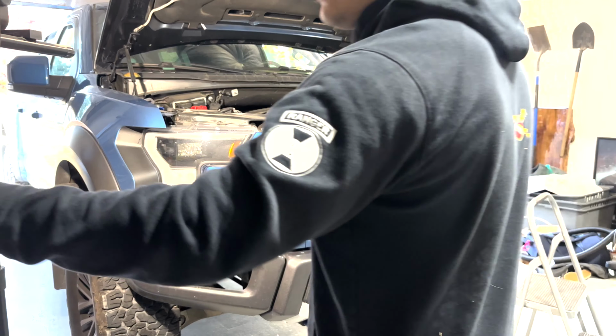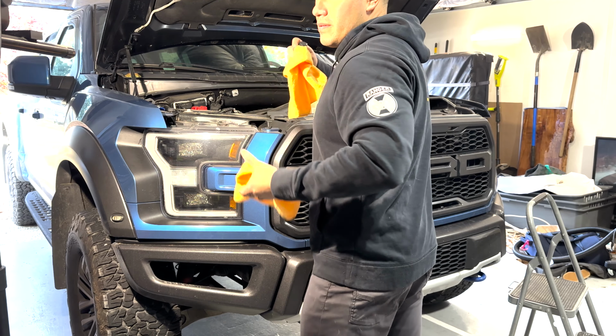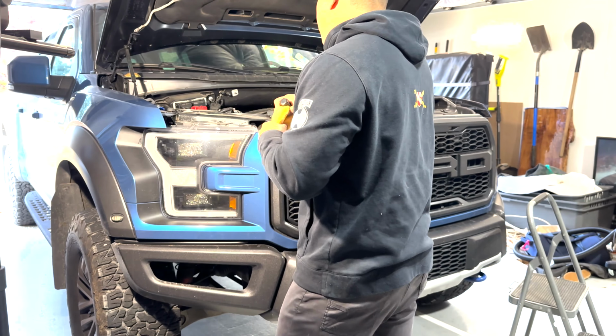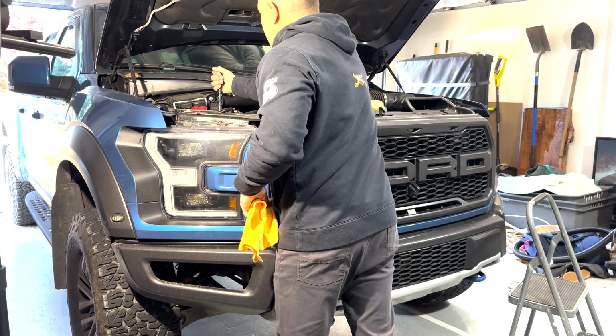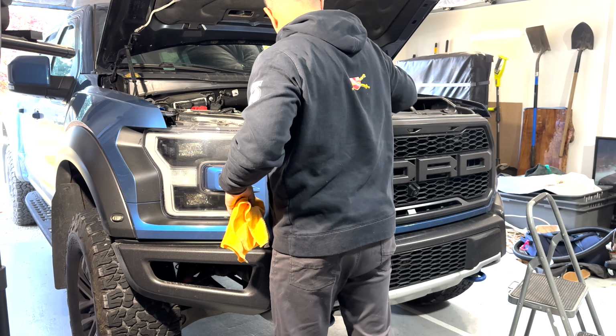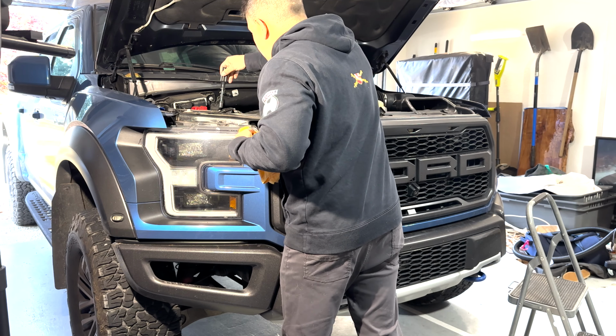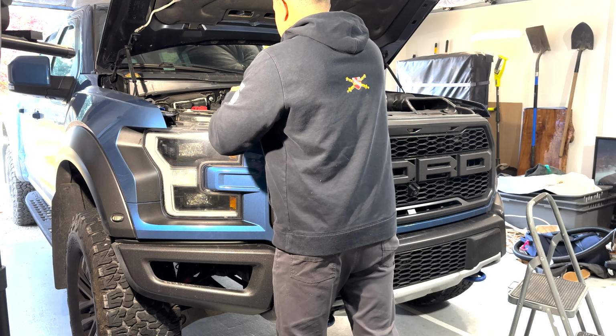And that's basically it. Again, the first thing that you're going to do when you're changing the spark plugs is disconnect the battery. So you're going to unplug the battery with a 10mm socket, go ahead and unscrew it, pull the negative terminal off, and make sure that you have something covering it up so it can't lock back into place and hit the negative terminal on the battery.